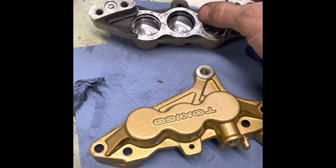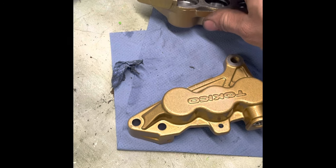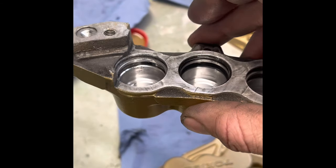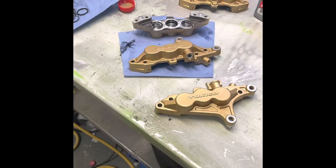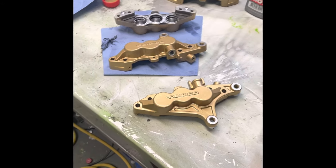At the end of the day, a little bit of corrosion won't harm them — it's just when it starts getting in between the piston and bore. But because it's already started it's hard to keep that at bay. It's a shame really. So I'm going to get all the seals in, then put all the pistons in.